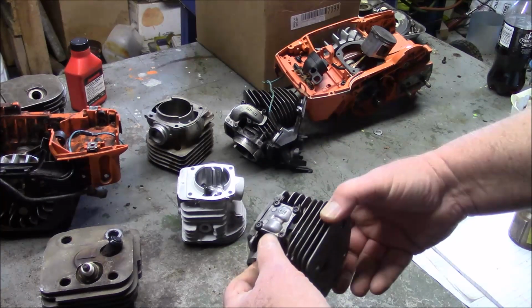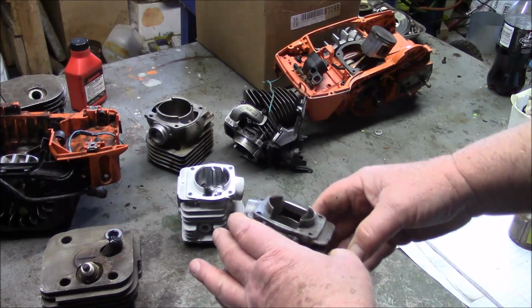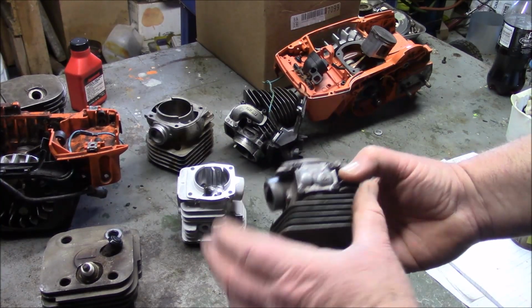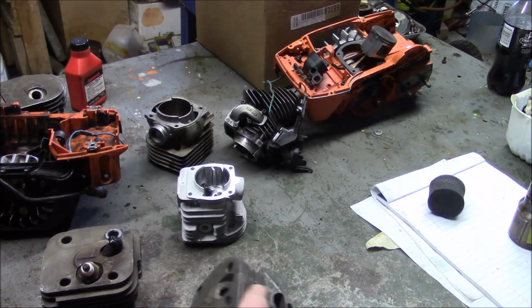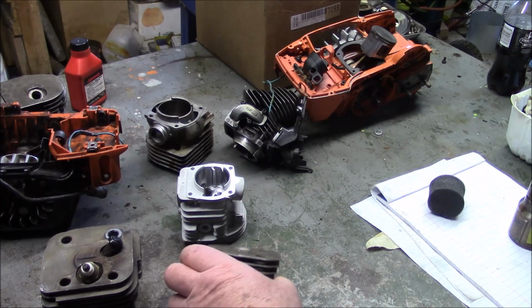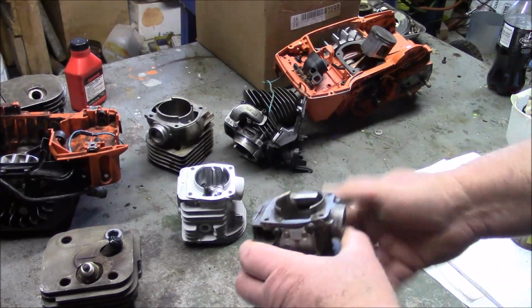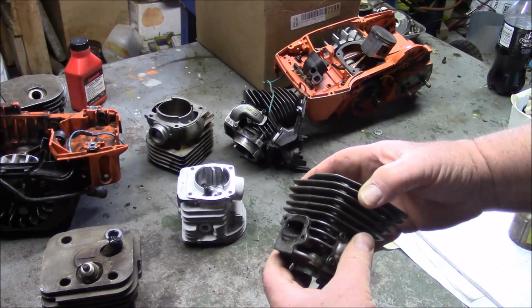In the 350 Husqvarnas, this was a cylinder from a 350 or a 353, combined quad port design with caps, and that was a pretty effective cylinder. It had one characteristic that made Husqvarna aficionados dislike it, and that's it vibrated differently and would vibrate the muffler off, but that has nothing to do with the port design, just something else altogether different.